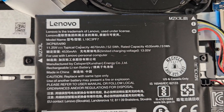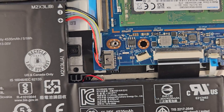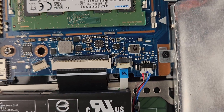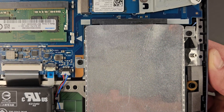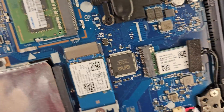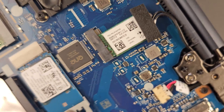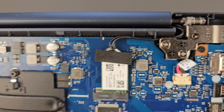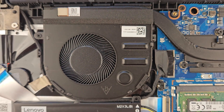Here's a closer look at the components. Your battery connection, your keyboard connection there as well. That's your 2.5-inch drive bay — it's empty. For yourself, if you have an extra drive, why not use it for additional space. That's your WiFi card, and that's your USB-C connection, which is not soldered to the motherboard so it's easy to swap if it's broken. And that's your CPU fan.